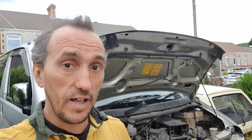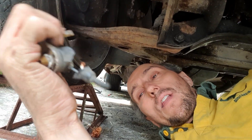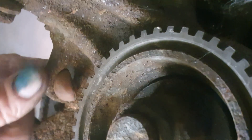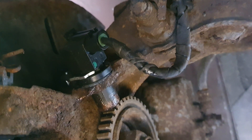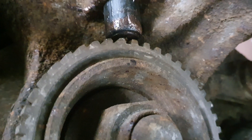Just got to get it off the hub and get it fitted - another job off the list. Finally, after hammering and chiselling, it is out. This is why you can't get second-hand hub sensors - they rot in there and they're a bugger to get out. There's all the copper from inside it. So the old one's out, we got that cleaned up and greased up and tapped the new one in. I had to take a little bit of sandpaper to it and thin it down a little bit because it wouldn't go in, then give it a couple of love taps with the Persuadotron. That's in - seems to line up well.